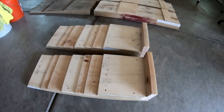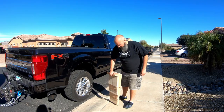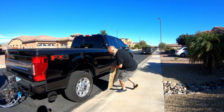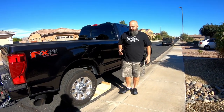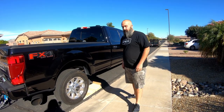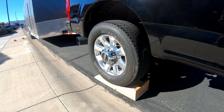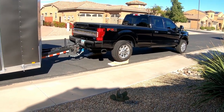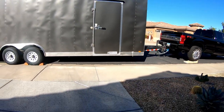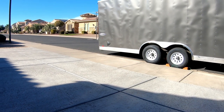Here are the ramps for the truck and for the trailer door. Let's go see if we can get these going and get that car in the trailer. Both sets of ramps are the same length. Roll it in up to the tire, run around and throw the other side on, and the truck will roll up and stop at that block — hopefully without falling off the other side. With the truck up on the blocks, it's elevated four and a half inches. That lifts the tongue and tilts the whole trailer down, dropping the back of the trailer three inches.